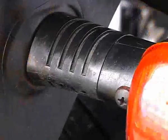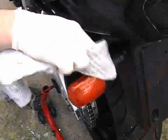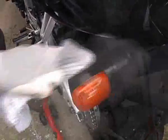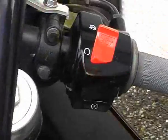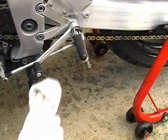Spray the liquid on the cloth for cables and pipes, and spray the parts where you're doing big bits like mudguards or where there's no chance of overspray or the parts are off the bike. If you leave them to dry out, you'll get a shinier finish than if you buff the cleaner off. One word of warning, don't even think about using rubber cleaner on your controls or seats or footrests. Naughty boy!